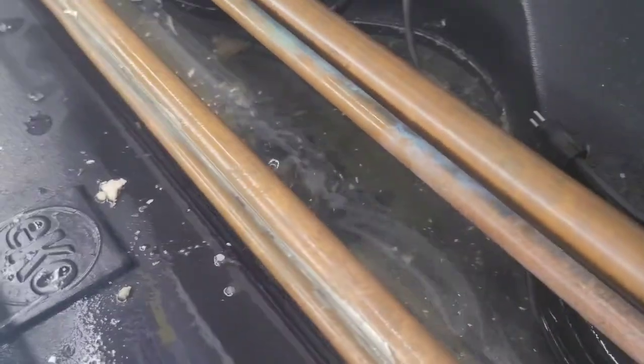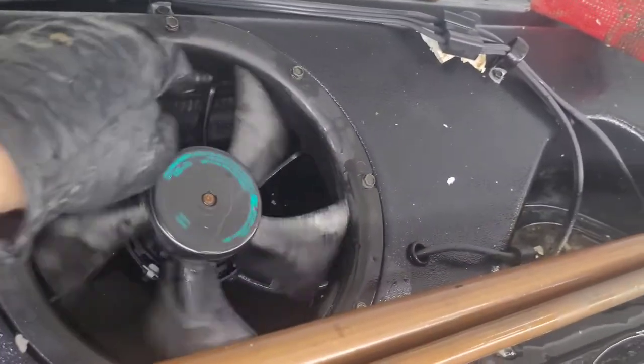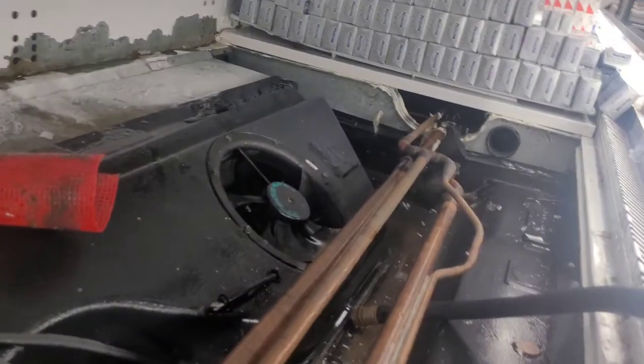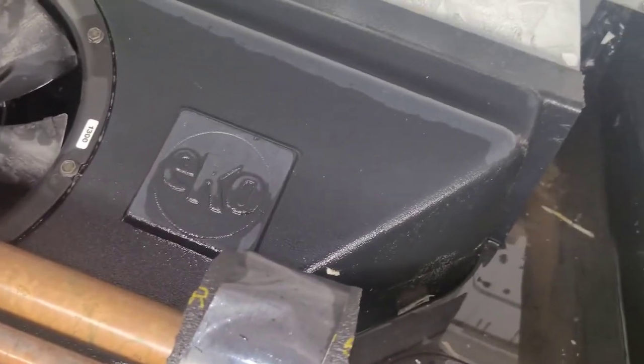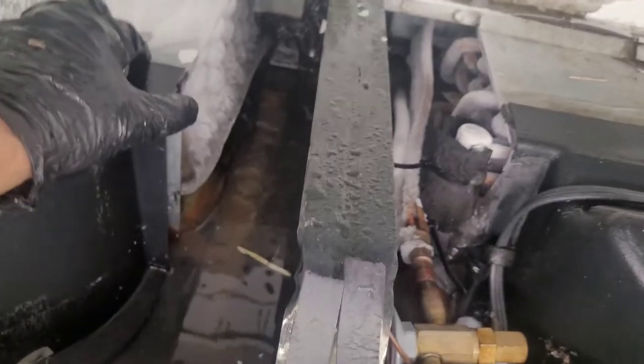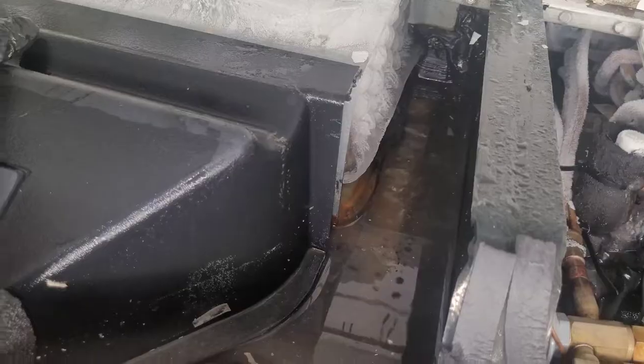To quickly recap what is going on here — this is the sequence of what happened. The drain's clogged. That causes the fans to slow down. In that case the fans stopped — the water might have shorted it, might not have. The fans slowed down, which caused this to freeze up. Once it froze up and air cannot move through it, the ice just grows. And it will not recover until it is defrosted one way or another.